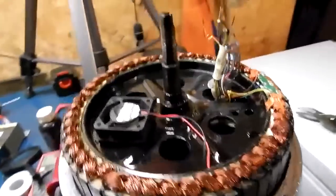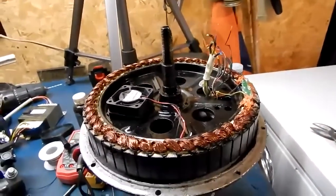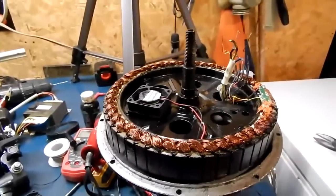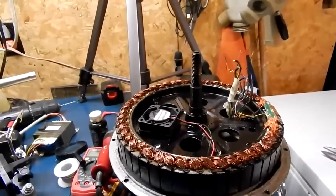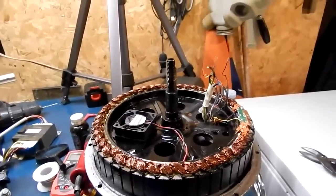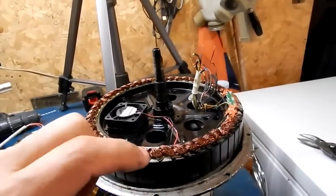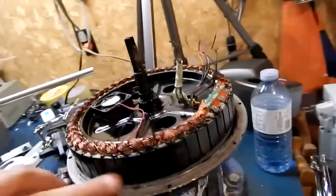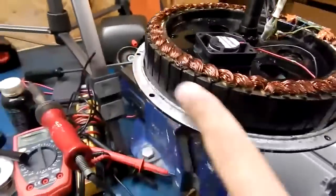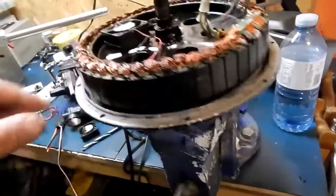Well guys, I spent yesterday pulling it apart and cleaning up all the rust. I never kept it out in the rain and I never rode it in the rain, so I'm not too sure why it had rust as bad as it did. The actual stator itself had so much rust that some of the laminate was starting to separate, which is bad. So I had to resurface that yesterday — spent most of the day sanding it and straightening it out — and then I put a protective coating on it just to keep it from rusting up again.